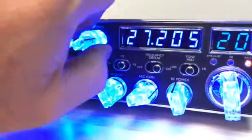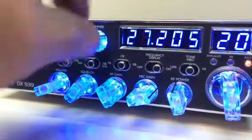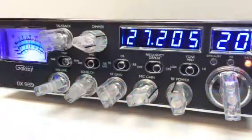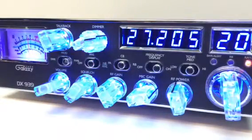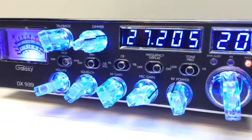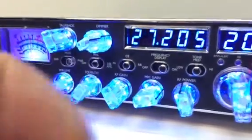I made it a dual dimmer — it also controls the Nitro knobs and it shuts off completely. There's a PC board behind there that connects these two knobs, and it had to be bypassed — jumpered actually. The PC board is in the middle of the radio, and because that board wouldn't fit, I used a dual potentiometer instead.